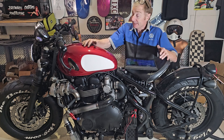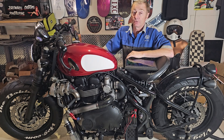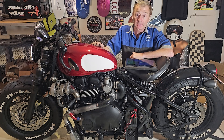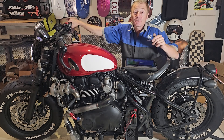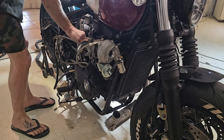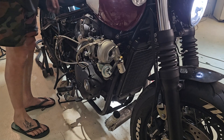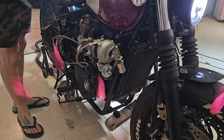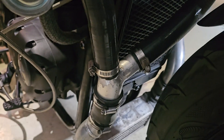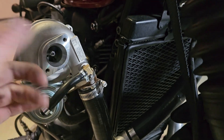What's happening now is there's a really slow, unresponsive throttle and it's running really rich because I think the dump pipes are putting quite a restriction on the exhaust at the moment, so it's struggling. I'm remapping it and taking quite a bit of fuel out to see if I can get it to run a little bit better on initial startup — this is going to be the hardest part from now: actually tuning this. Now I've got my boost hoses connected up. I need to make some proper metal pipes, but this is just a prototype so until I know it works I'm not going to invest too much time. I don't have any air filters on it yet but you don't really need them in the workshop.